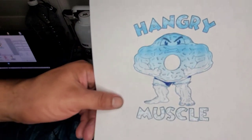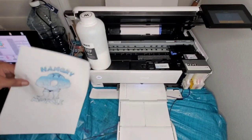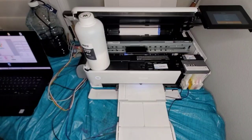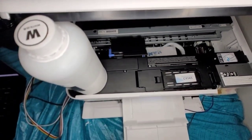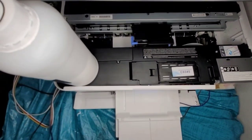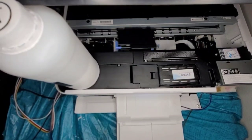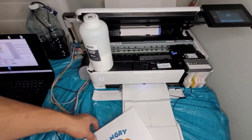All right, so that's the end product. I put white on there. I'm going to print one without white just so you guys can see the coloring — I think you guys kind of get it. The reason it's probably a little bit bluer is because cyan is still feeding, overfeeding, or because my color is set really high from trying to purge the printer earlier. So we're doing it again — not printing white on this one. That's the white one we printed, and this is the one we printed prior; it has white on it but was only printing magenta and yellow as well as white.